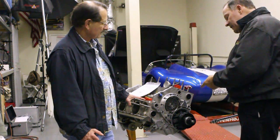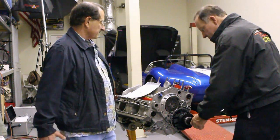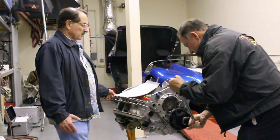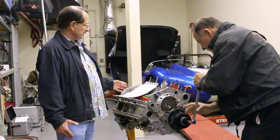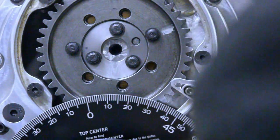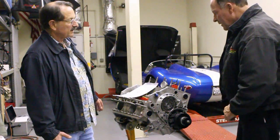Okay, so now to check this — do two full turns and look for 50? Yeah, you could do that to see if everything comes back to the same position. The reason this works is that by setting the intake opening to 20 degrees before top at 50-thousandths lifter rise, you're coordinating that opening sequence with the centerline position of the cam — because when the cam is installed straight up, that's what you get: intake opening. How'd we do?